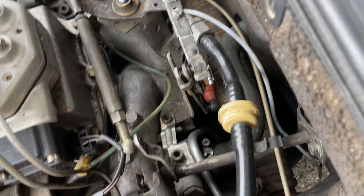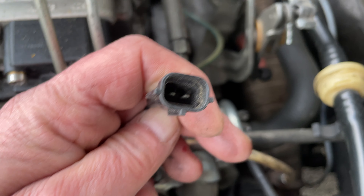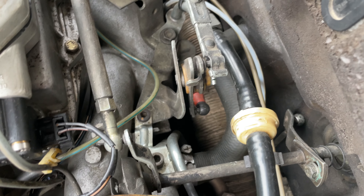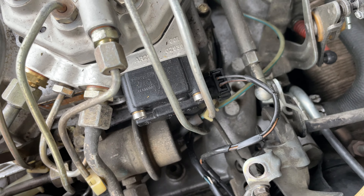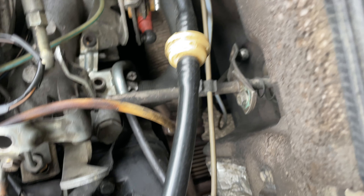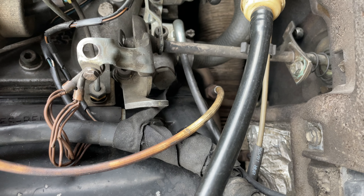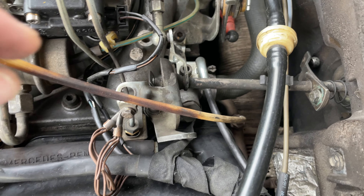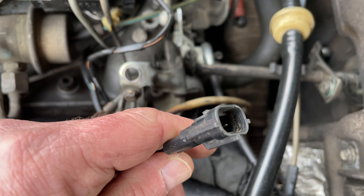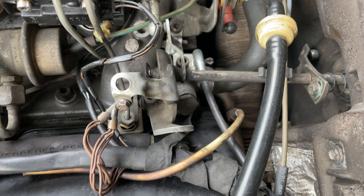I have to redo my wiring harness here a little bit — this is getting all brittle. And I still need to fix this — this is the EGR temperature probe. This is an American plug; this was retrofitted in California for California versions. The federal versions don't have this. What I did is I put a resistor in here — a 51 kilo-ohm resistor. This usually plugs in here and this is a non-Mercedes-Benz part. This thing should have, I think, 50 kilo-ohms when the exhaust temperature is around 180 to 220 degrees Fahrenheit. If someone has a functioning EGR temperature sensor or knows which model this is, or which American or Japanese car manufacturer uses these plugs, please leave a comment.